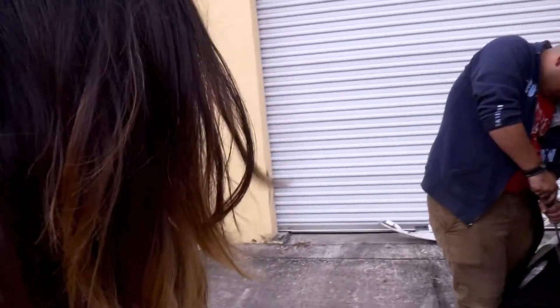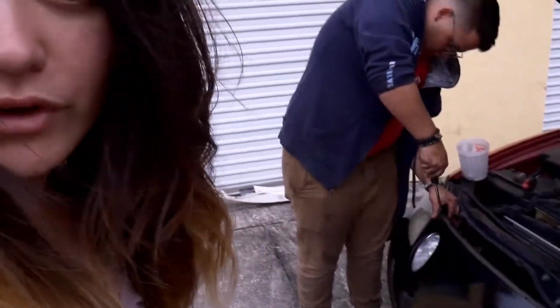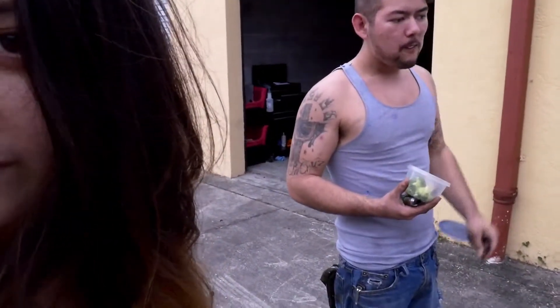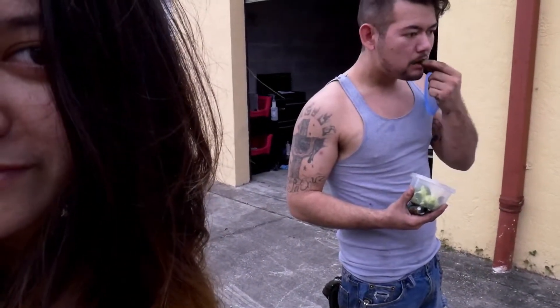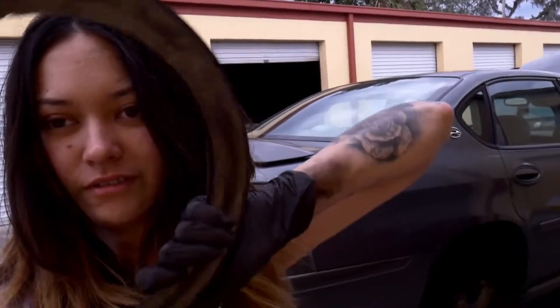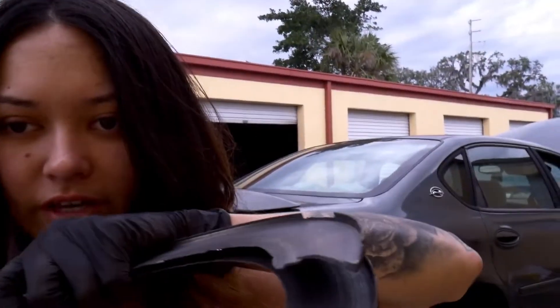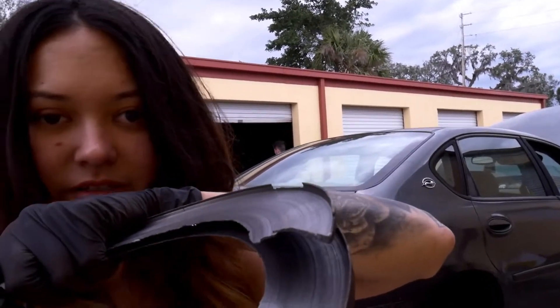So yeah, that's the painted bumper. Frank was a little impatient and just wanted it painted. It still looks better than it did, but you can still see a lot of the sanding scratches and body mark stuff. Realistically, we should have put filler primer on the bumper — we skipped that step — but eventually he's going to buy a new bumper anyway, so it's just something to make it a little more aesthetically pleasing in the meantime. Lex's bumpers are a bitch. I kind of want to keep these as souvenirs. This is probably the worst I've ever seen. See that lip on there? That's what you call car neglect.